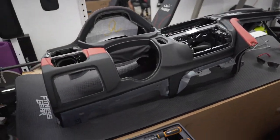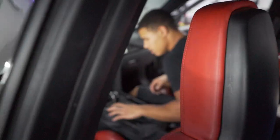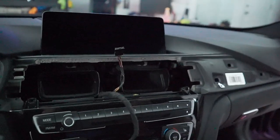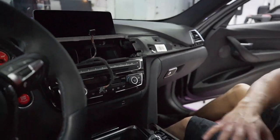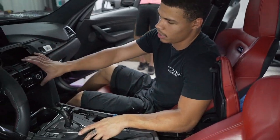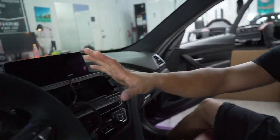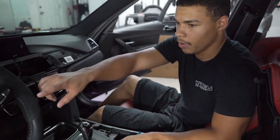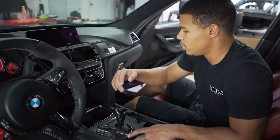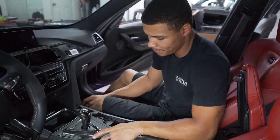Makes everything look super premium. Ben already has everything ready to go. So we're disassembling the center console — we already took out the AC unit. Once we get some more trim pieces and bolts out, we'll work towards moving the center console. Then I'll work on removing the IHKA, then the CID — the center information display. Then we'll hop over to the steering wheel, remove the airbag, remove the steering wheel, start with the cluster, and then remove the airbags from underneath each side and some panels.